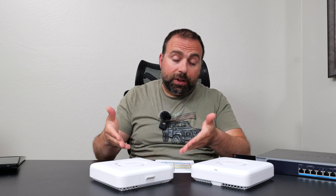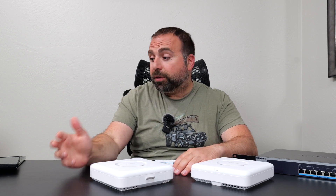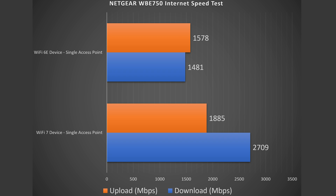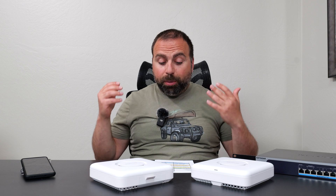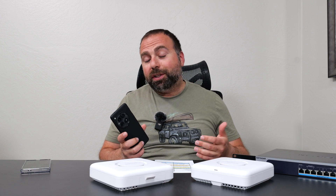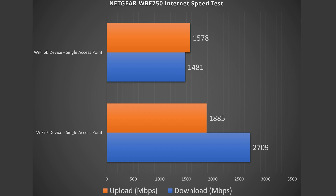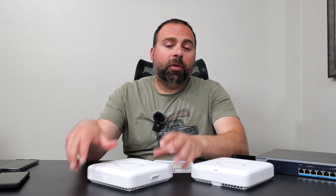Let's jump to the internet speed test. When accessing the internet, you're limited by your ISP speeds unless the access point can match them — which in my case it can. My internet speeds are 5 gigabits per second upload and download, and this access point supports up to 10 gig speeds, so Wi-Fi devices are the limiting factor. We still got some super solid numbers with the Wi-Fi 7 device and with Wi-Fi 6E devices — very fast speeds. Imagine getting 2.7 gigabits per second download on a phone or laptop — those are some really absurd speeds.